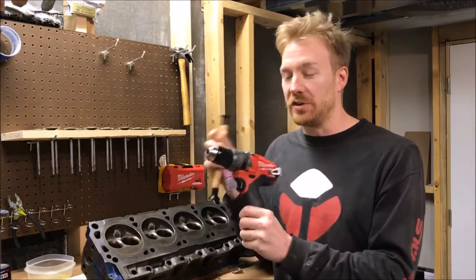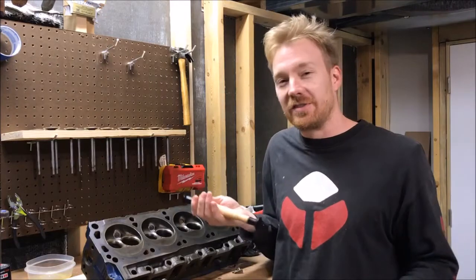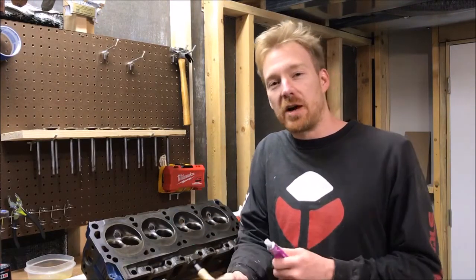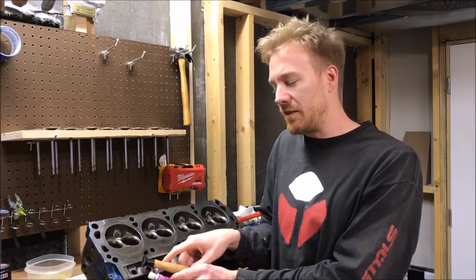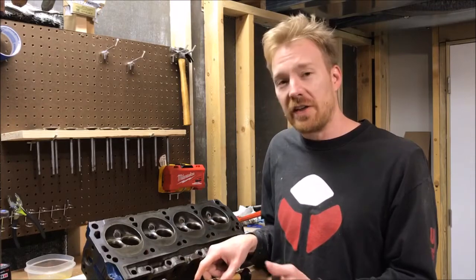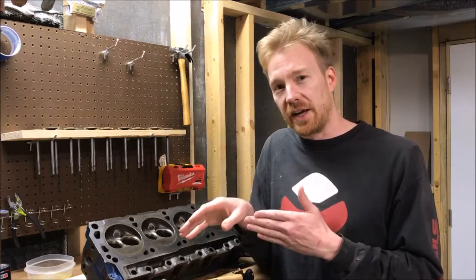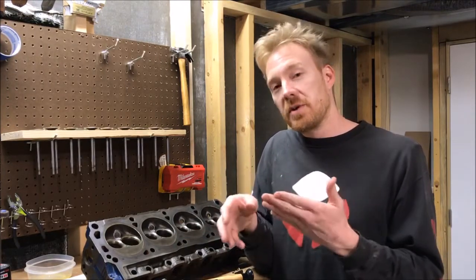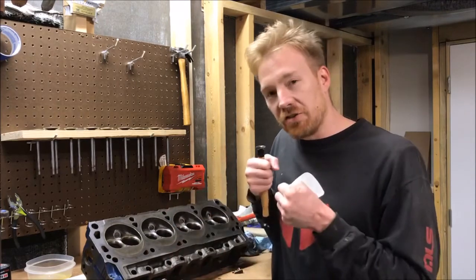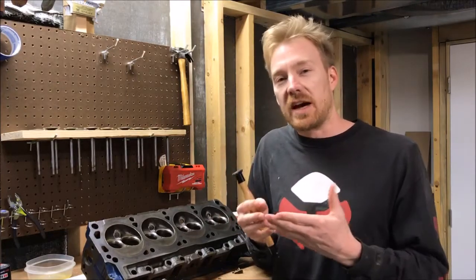The other thing you'll need is a power drill. Now, there are videos out there by the pros who say not to use a power drill, and a lot of those videos reference people using drills on absolute max speed — they're very loud, and some criticisms are that you can't hear the compound thinning out and the grinding noise getting quieter over the motor, not to mention pressure differences when you're jamming a drill with a tool like this on the valve and how that could negatively impact the valve seats.